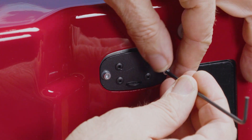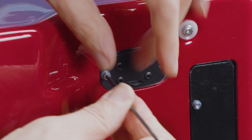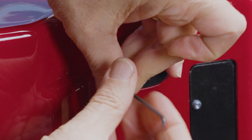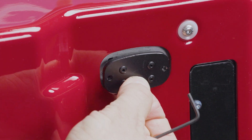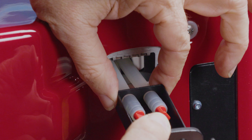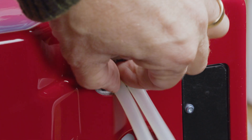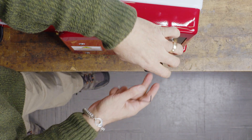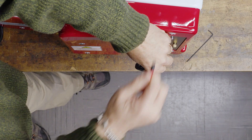Next, directly above the sight glass, we're going to take this little tray out and pull out the two hoses that we're going to use to put water in the machine. We're going to take these two screws out — I recommend putting those in the tray on top so we don't lose them. Now we pull that tray out and you'll see these two hoses. Sometimes the hose gets kinked right here, so check it and make sure it's not kinked. If it is, just squeeze it and that'll pop it open. Now we can pull these two caps off.